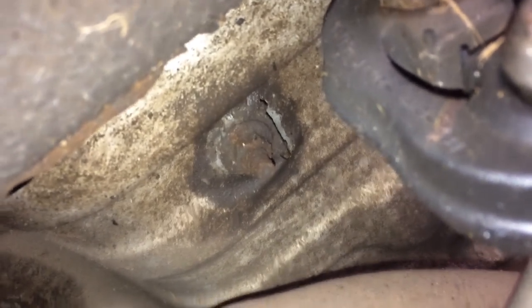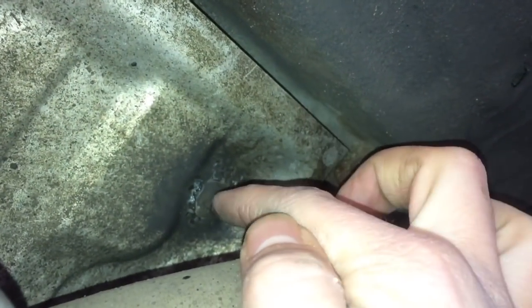I've got the car jacked up. The exhaust comes from the engine and comes down here. The first thing I've noticed is this heat shield here — there's a fixing there and another fixing just there — and they're corroded. So I'm going to have to take these off and put some washers on there. There's one at the back here which is completely corroded, and I think this is sitting on something and causing a vibration.